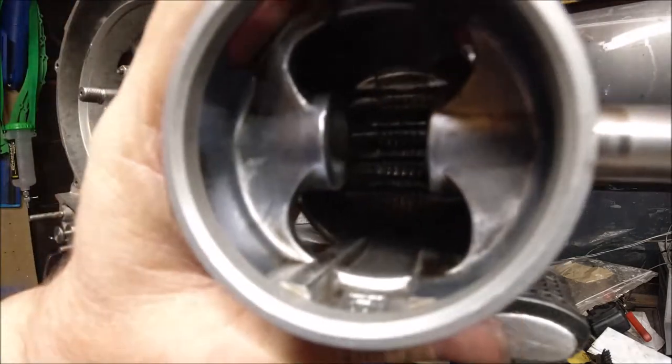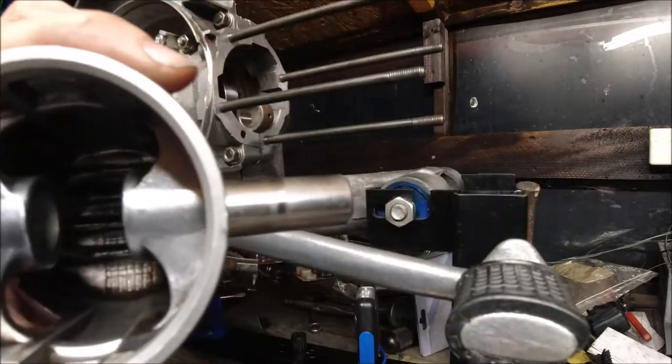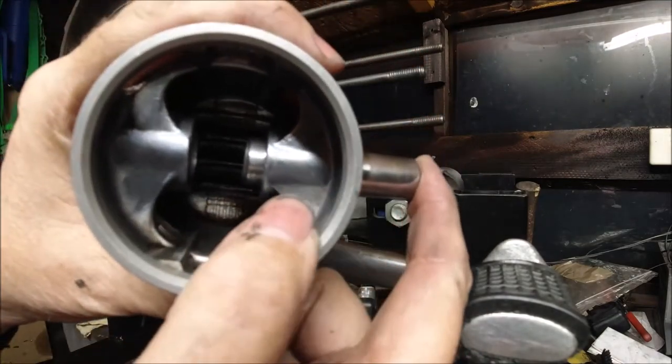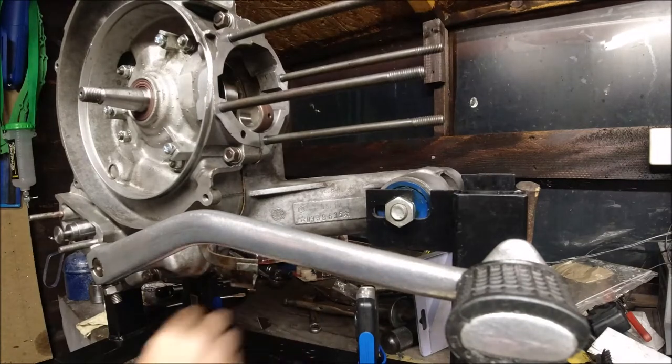So that's our downside as we're looking at it. I'm going to start the gudgeon pin in from the kickstart side — just slightly bring it in. I'm trying to give you a sideward view of that. That's the gudgeon pin — see it coming in? You just want it slightly in, and then what we need to do is get our small end bearing.